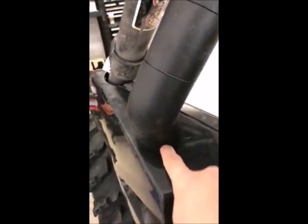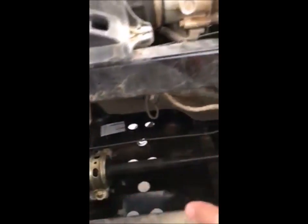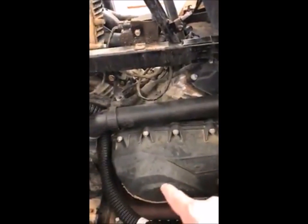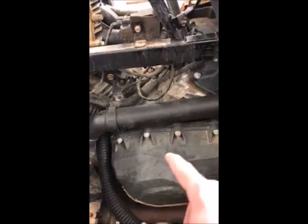Right underneath this panel — this panel comes off — another two-and-a-half inch hole here, and then up to the snorkel. You remove all of the CVT inlet ducting that goes right here. There's a big tube that goes here. Follow it back and it goes to the CVT — so you've got a dual CVT system.